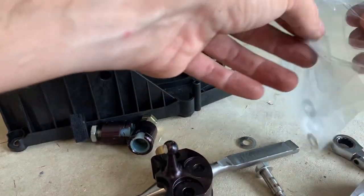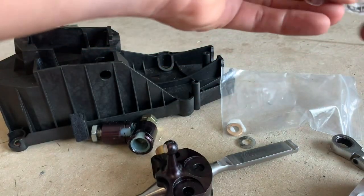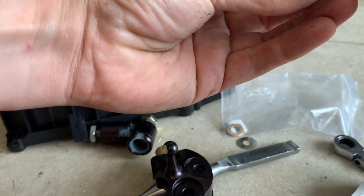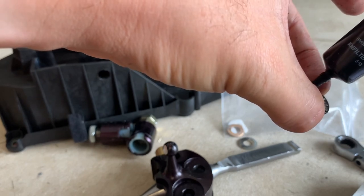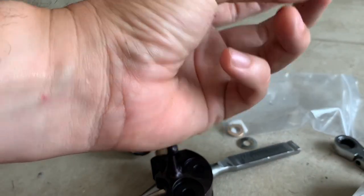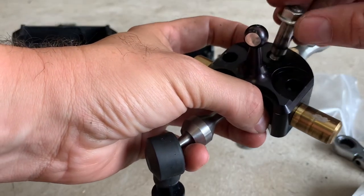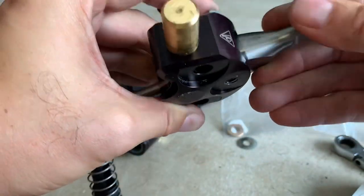Let's get this new setup in here - pretty cool little bearing. We've got some high-temp grease here, just put a thin coat on. It doesn't call for much grease. Now, you're supposed to put the needle bearing on the peg side, then get the bolt and align it.